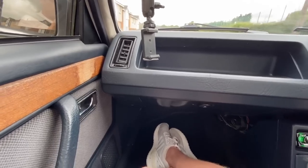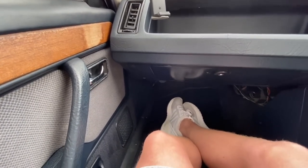Any aircon? No aircon, no - not that privileged. It's got electric windows in front though. Did you get the wheels new? No, they came off a VW Caddy van originally. Were they? Yeah. Did the offsets just work? Yeah - no spacers on them, nothing, straight on. Because luckily these have got the same PCD as a Volkswagen - 5x112 - so you've got a massive choice of wheels you can pick from.